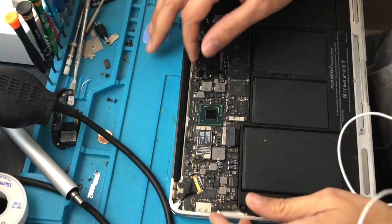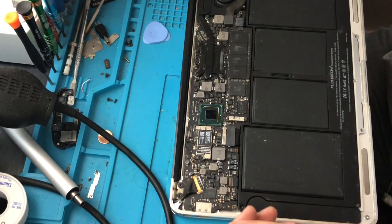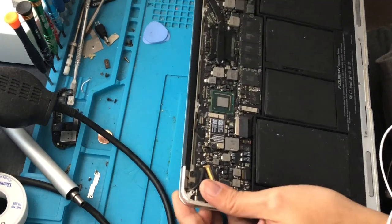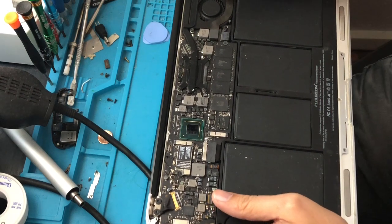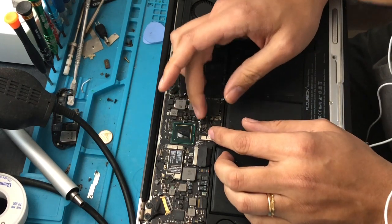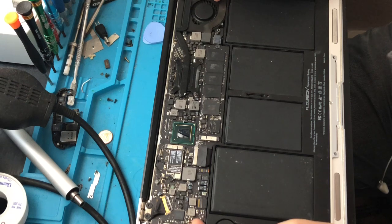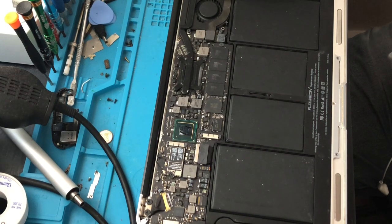After I opened it, I saw it's a little bit dirty due to dust. I had not been working with this for a couple of months, so during this week I decided to work on it. I was asking for software updates regarding the OS, and after that it was giving me a lot of messages saying it was unable to upgrade the software. I tried a factory reset to see if that resolved the problem, but it kept showing up. After that, it started giving a sound of three beeps every time I turned on the laptop.